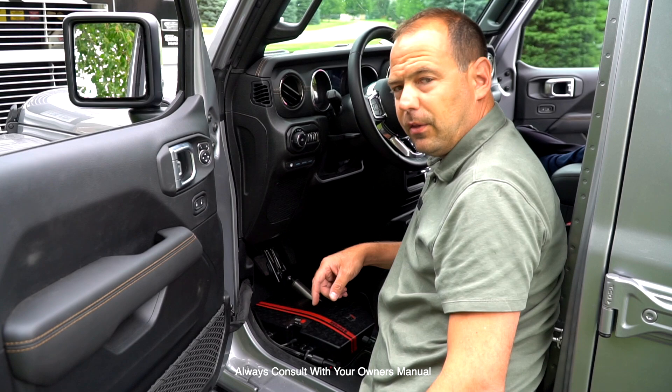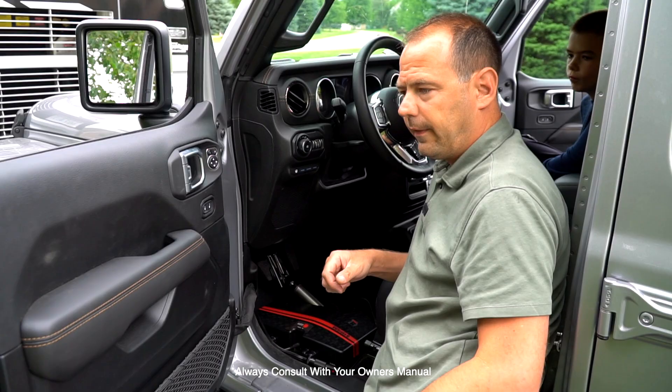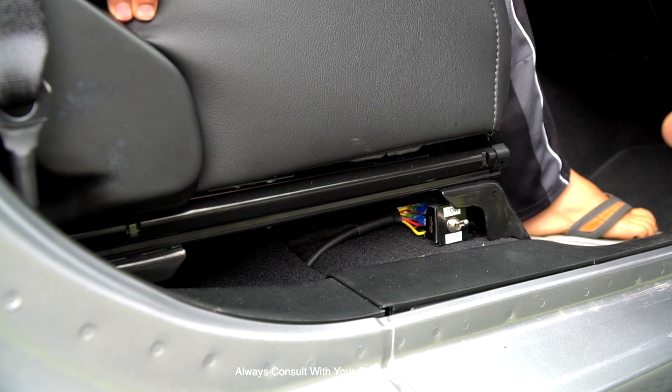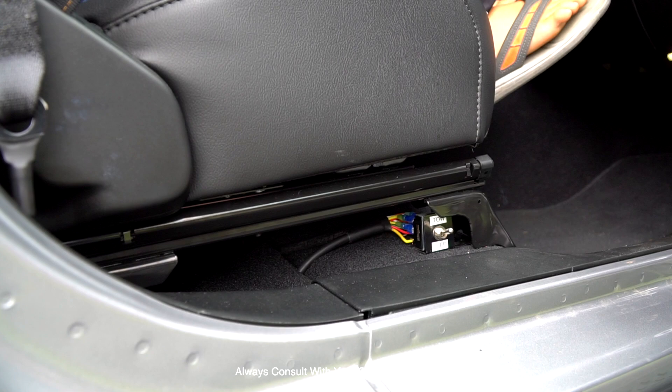The last step inside the vehicle is to make sure the power from the RV is going to power the tail lights. Charlie switched the mode from Jeep to tow. What that does is take the power directly from the RV — it no longer has any connection through the Jeep, so there's no back-feed of signal. Now all the power for the tail lights — braking, running lights, and turn signals — will come from the RV.